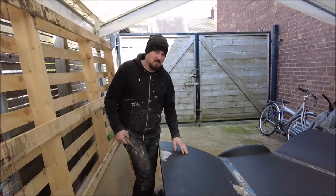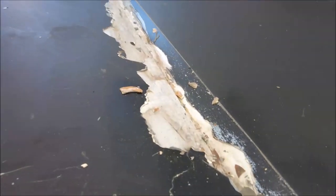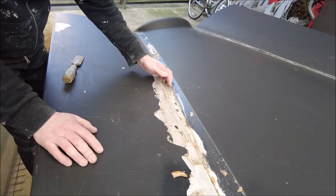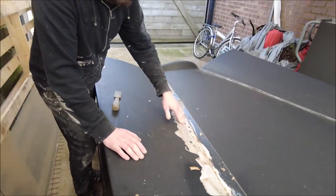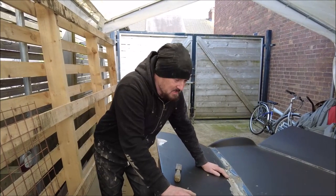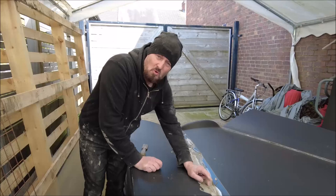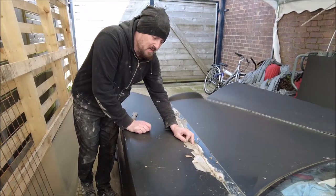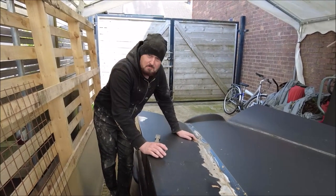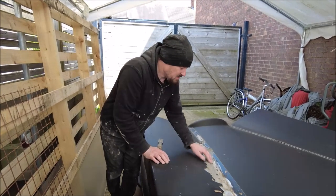Let's take a look at Dualatron and just the general state it's in. It's awful. One of the worst parts is just here — this has just totally come away from the frame, come away from this other panel. Everything's moving, nothing's very stable. The reason this has happened is that I made this boot using one piece of aluminium and another, and then all I did down here was fill it with fiberglass compound. It's just not good enough. This has got to have mat and resin on it, sort of two or three layers minimum to hold this kind of joint.